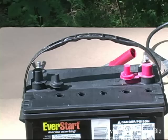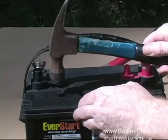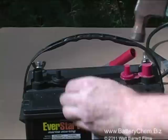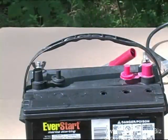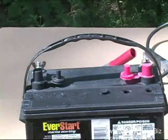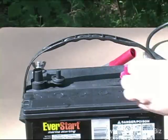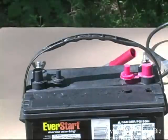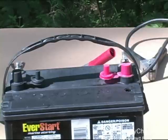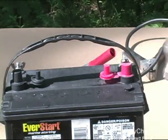We are replacing the caps now just to show you how easily it can be done — we can remove them again tomorrow just as easily if we want to do more service on the battery. My experience tells me that the battery is in fine condition right now and could go right back into a vehicle or into a boat, and the generator would finish charging the battery normally anyway. That concludes this training video brought to you by the makers of Battery Chem. Battery Chem will save you money. This is Walt Barrett for Battery Chem.